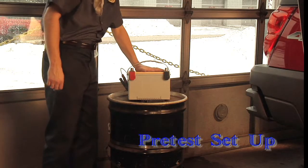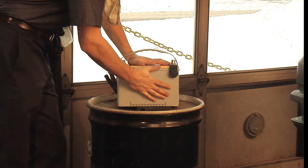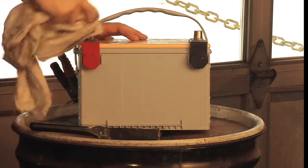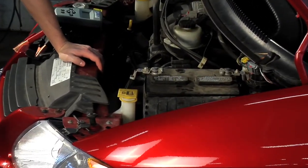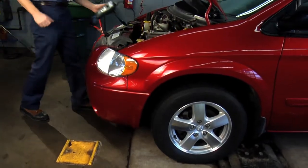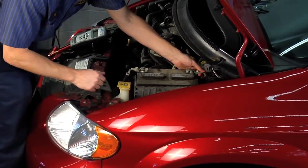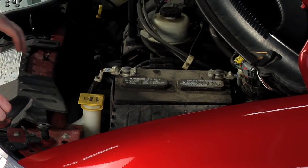To prepare for testing, follow these steps. Check the following: if the battery being tested is frozen, let it warm up before testing. Make sure that the terminals of the battery being tested are clean and dry; brush and clean gently if necessary. If the battery being tested was recently charged or is a used battery, let the battery stabilize 3 minutes before testing. If testing a battery installed in a vehicle, make sure the contact between the battery terminals and cables is not oxidized or loose, which causes cranking and charging problems and may falsify the test results.